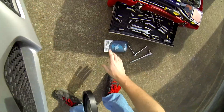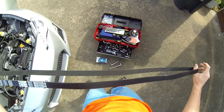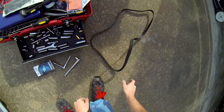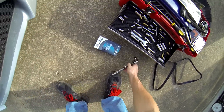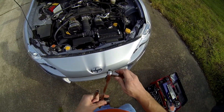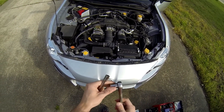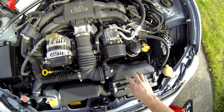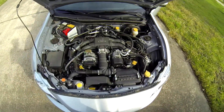The first thing: we're gonna keep this belt box intact in case this belt is the wrong size. We're gonna check and make sure everything's good. This is a Dayco Poly-V belt, so it's a much better quality belt than the crap they send you from the factory. We're gonna need a 10mm quarter-inch ratchet, and a 14mm three-eighths. Unfortunately I don't have a 14mm, so I'm using a nine-sixteenths, which is good enough — not ideal, but it'll work.